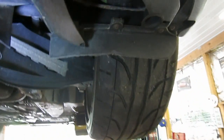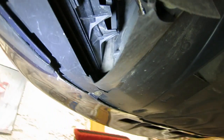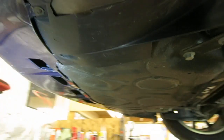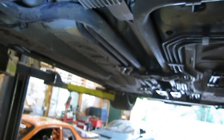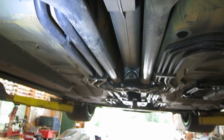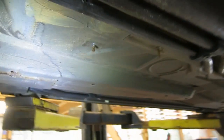And you have two radiators. See if I can get the camera to turn around here. You can just see the radiator fan here. So there's actually a radiator and an AC condenser in the nose of the car, and looking right through the front vent, you can see the AC condenser. And these two great big pipes that are running down the center tunnel, those are your water pipes. So one is water to the radiators and one is water back.